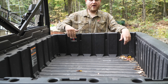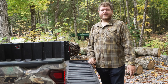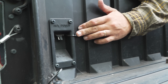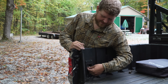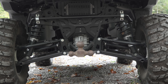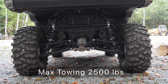You can see all these slots in the bed wall — those are for lumber, so you can put dividers in. There are holes and slots in the top for accessories as well, and you get the standard tailgate setup. One difference here: there's 12-volt power in the back of the bed. However, it uses a very unique plug rather than a standard cigarette lighter style, so you may need an adapter — a little strange. You also get a standard 2-inch hitch receiver. Right on it, it tells you max trailer weight: 2,500 pounds, which means your tongue weight is 250 pounds.